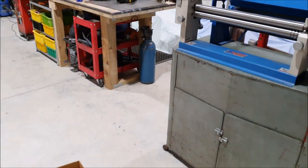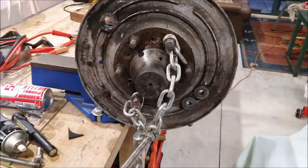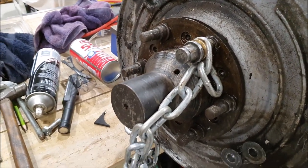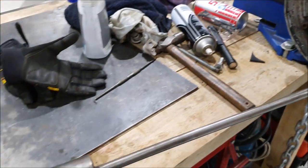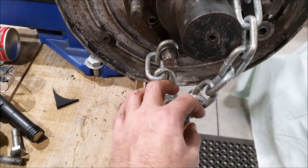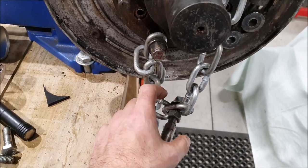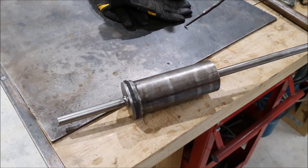The front hubs — I'm still working on these. The one that just came off the axle where the kingpin dropped out, I'm trying the same slide hammer trick with it held in the vice. This one seems really stuck so I've squirted some penetrating fluid in. It seems to be working pretty well, but I have to be careful not to damage the threads here. If that happens I can always just cut it off and weld on a new one, but it works fairly well.